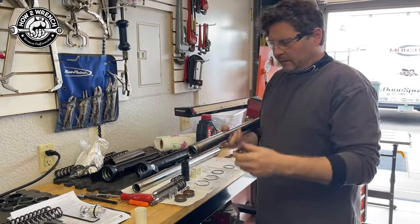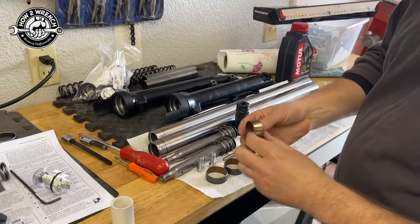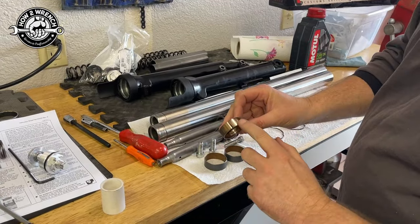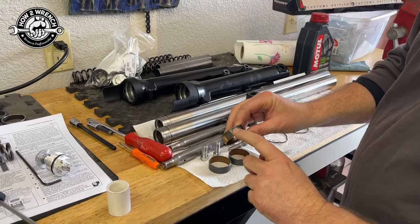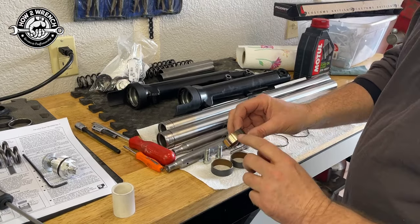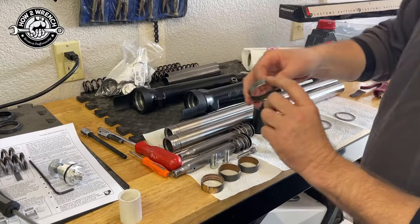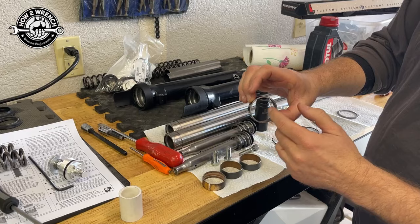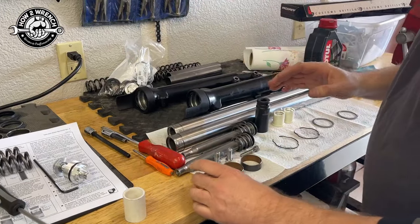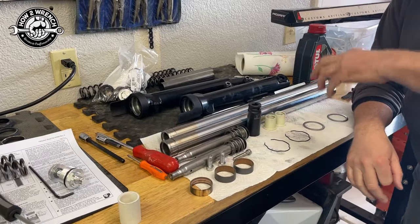Quite often when I get these apart — if you want to come closer — you're going to see something just like this. You can see this worn one. It's not the end of the world; this was caught in time. It was just the coating that came off — it's like a Teflon coating. You're looking at the outside surface here, and on the outer bushing you'd look at the inside surfaces where that coating would wear off. Here's the deal: you have no idea if this stuff is bad until you take it apart.